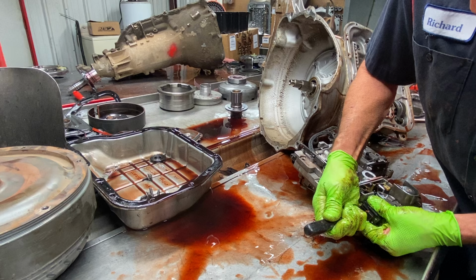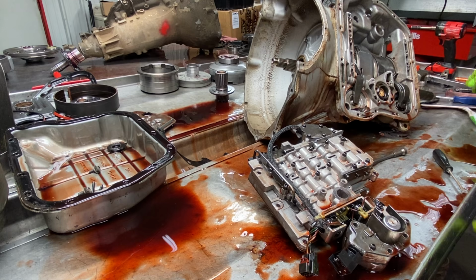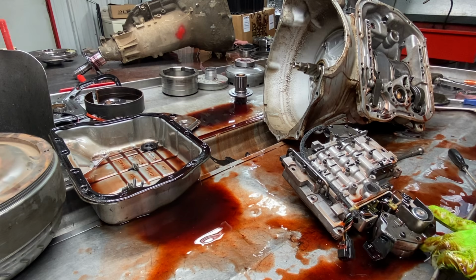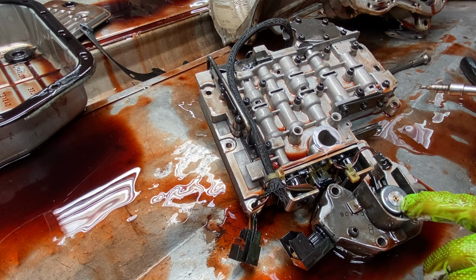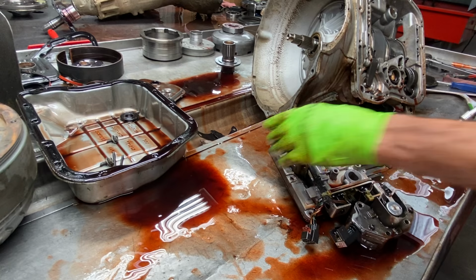1996. We'll get in here and unlock our lock for the governor pressure sensor. And then you can get in here and pull up on that and unlock your governor pressure solenoid. Now you can tell here, this is an aftermarket. It's not OEM just by looking at the adjustment screw right here. Your OEM is just a smooth cap. See that? Just a smooth cap. There's no screw in the middle. I like to use the OEM. I get better readings with it. Everything about it.